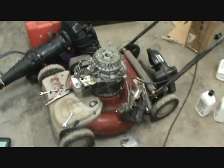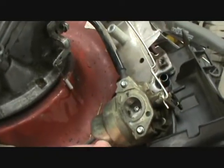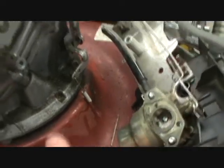This is my Honda self-propelled lawnmower, which I've pretty well completely stripped apart. The reason I did that was to clean out this carburetor, which was totally full of gunk. This is your float bowl here — you take a nut off the bottom, this piece comes off, and it was just totally full of garbage. It had sat through fall and winter with apparently some pretty rotten gas, and there was some water in there and it had corroded, so I took that out and sprayed it out with carb spray.